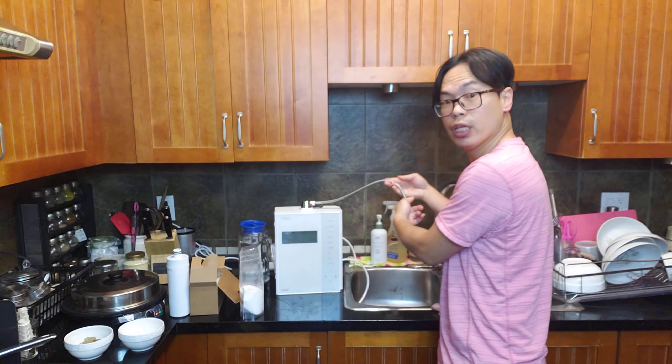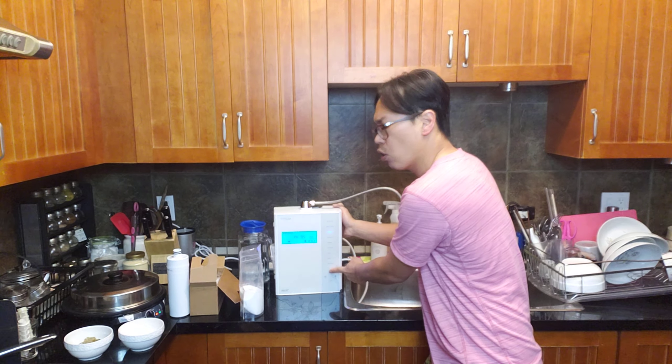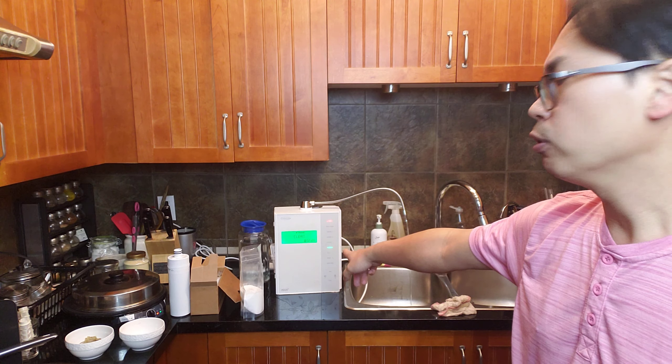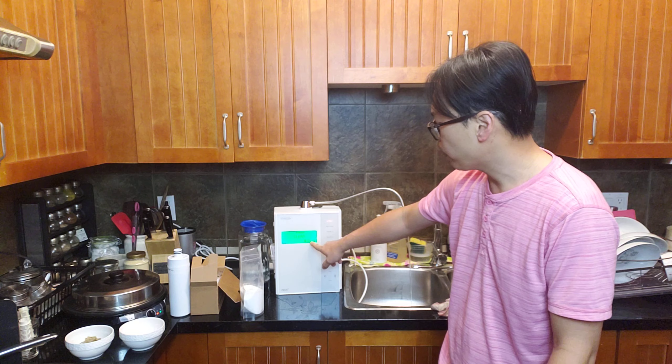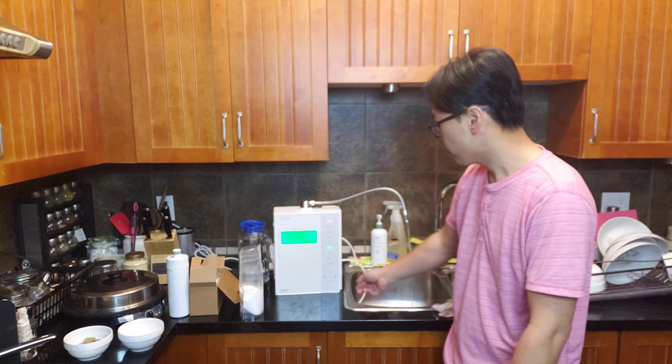Face the machine — this will be automatic. Wake it up, press and hold the mode button. When the screen turns, count to four, then press and hold the power button. It goes into a clock display — for example '2125' — that's the time for the clean in seconds, counting down one second at a time. It works out to about half an hour.